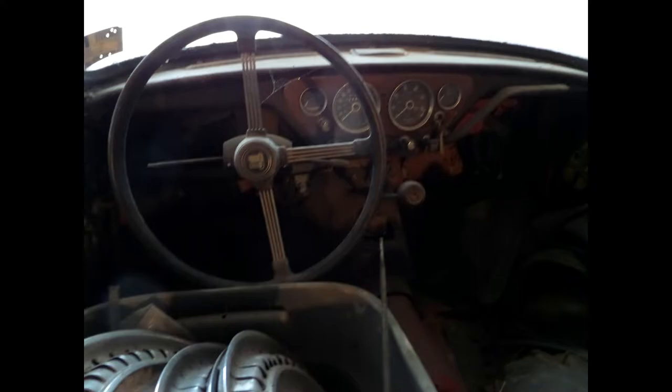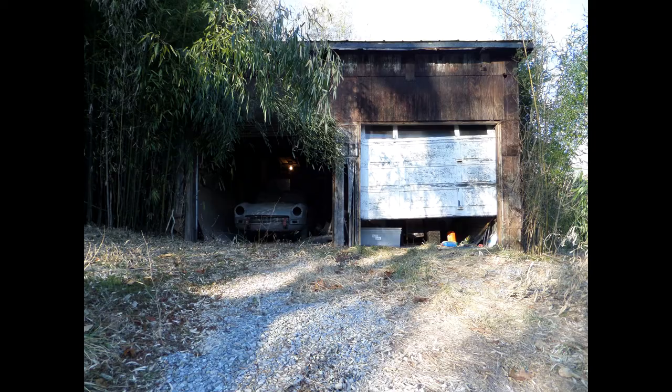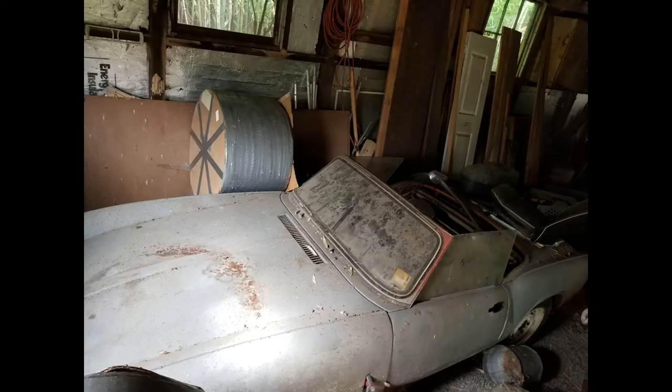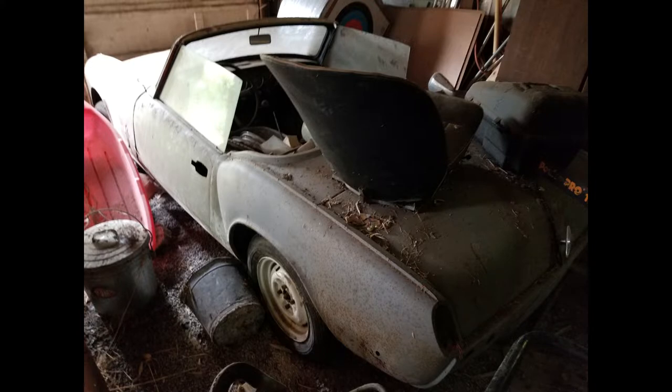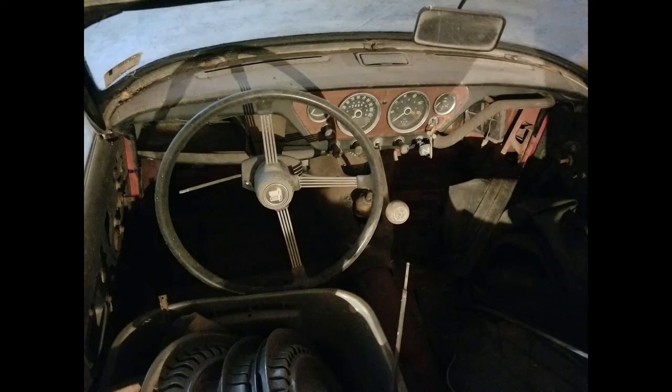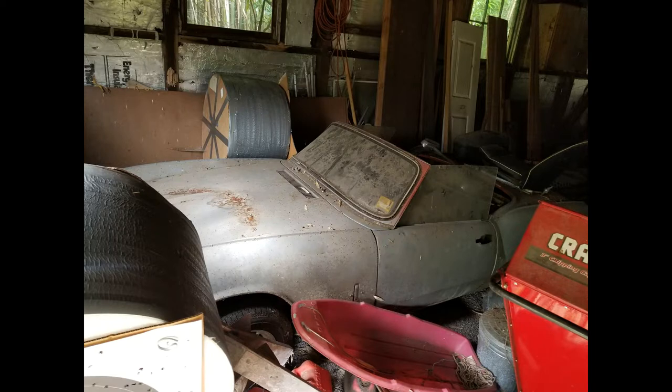Yeah, so I got that stuff. I'm gonna use brake fluid for the clutch since that's pretty much the same exact stuff. And the clutch master cylinder is filled up with a bunch of gunk and it's really nasty. So I gotta completely flush it, but yeah, it's about 20 degrees out again. I forgot that it's not supposed to warm up until tomorrow, so it's time to work on it.